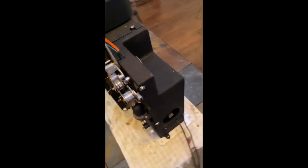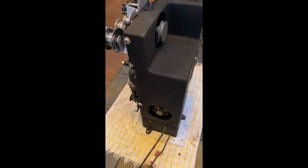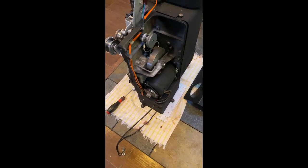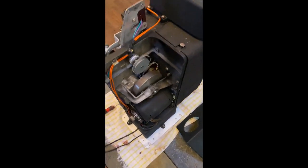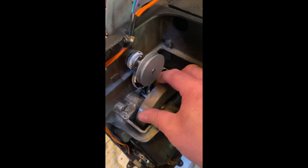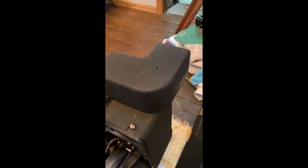You also have to remove the belt that goes from this pulley up to the reel. To get into the projector and see what's going on, let's take some covers off. The first is this rear cover — there's a screw here, here, and here. With that cover off, you might as well check the sound drum: make sure it spins, it's not loose, nothing's hitting in here. It'll have a little bit of play but it shouldn't be bad. Then the next step is to take off the chimney using these four screws.